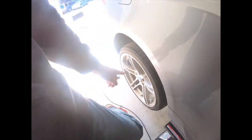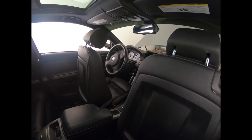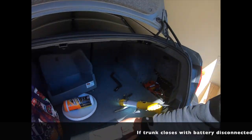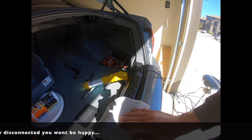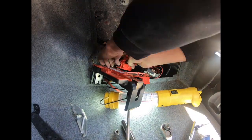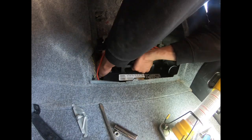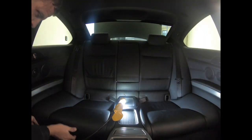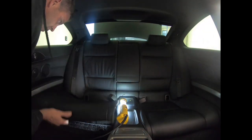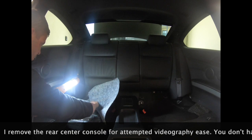So we have the car lifted, loosened up the lug nuts on the right side wheels for later when we run the power wires, seats all the way forward. I'm starting to disconnect the battery — you're actually going to have to take the battery out to run the wires into the little battery compartment. I always put a rag over the latch so this thing can't close on you. The back seats basically just have some clips on the front. Here is the access to the low-pressure fuel pump right here.